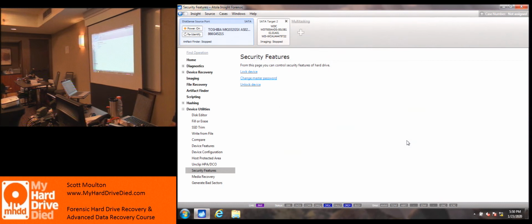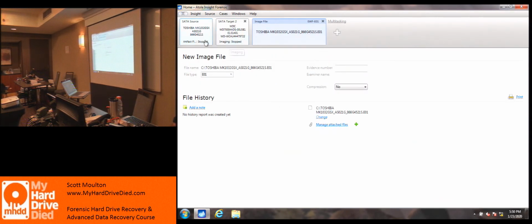So you can create an E01 and it will actually write the data as it's writing from one to the other as an image file. And so you can literally turn on and off compression. If I recall, it didn't have all the same options. Like if you do this live, it does not have all the physical options to make the image file with the content in it at the same time, doing all of the recovery features. Do you know if that's segmented? I believe you can tell it not to be. I believe it is not a segmented file.